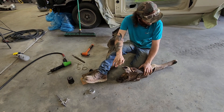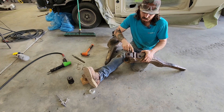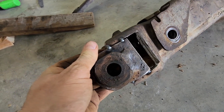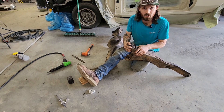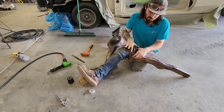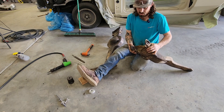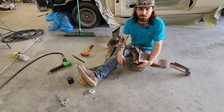I think that's going to be it for this video. We've got both beams torn out of the truck. We've got the ball joints cut out and positioned with practically zero camber, which is nice. If it's not perfect, I have the adjustable camber bushings, but this is extremely close to where it needs to be. We've got the lower ball joints tacked in place. I'm going to keep working and make another video — we're going to weld this up, plate this hole, plate over the bottom of the beam, add some triangles for gussets on the ball joint, and then weld up the inside and plate the inside as well. That should be plenty strong to not bend or break the ball joint off.